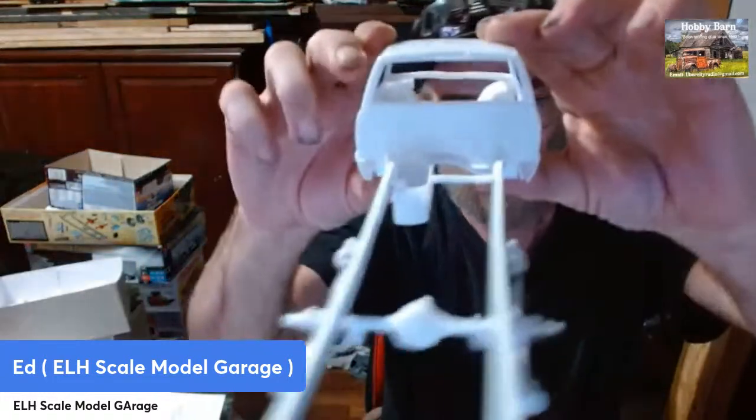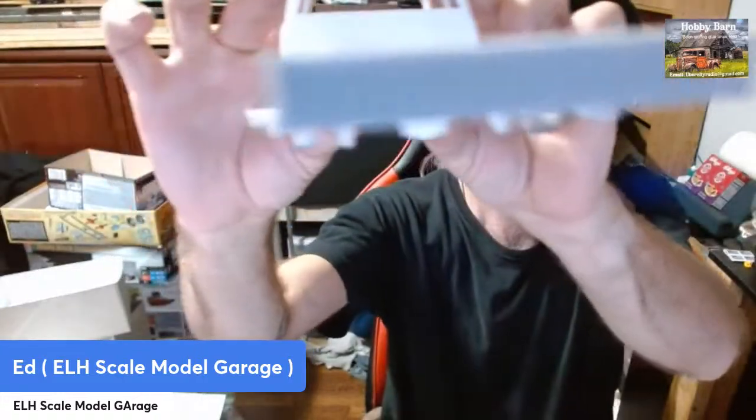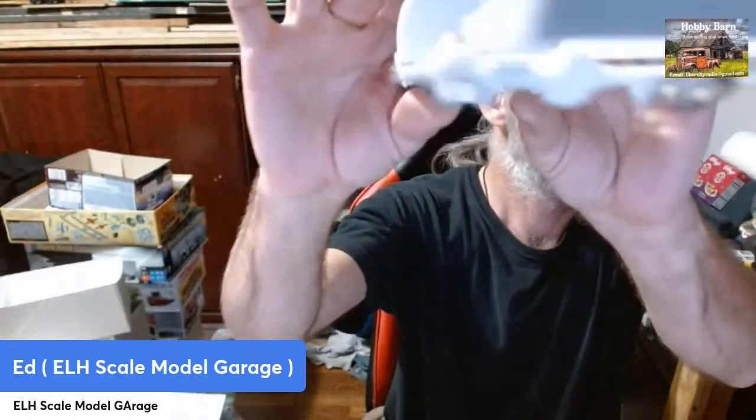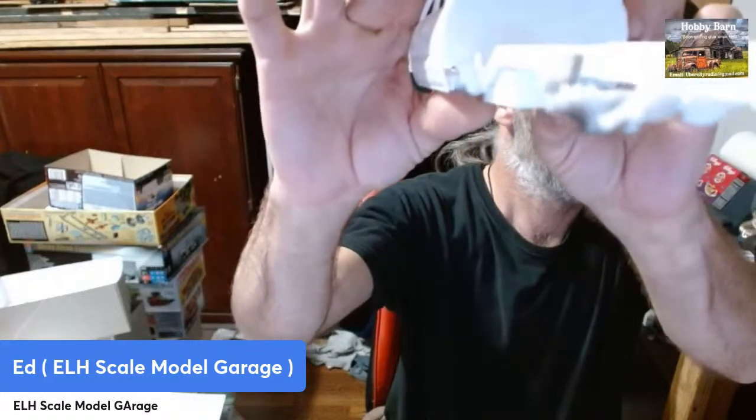That might work. I mean, make it actually a floor pan in the body, to tie both rockers together. And then you're just basically setting the frame back down onto it where it belongs. Because that's a lot of work to secure that so it doesn't snap. But that's the last thing you want to happen, is to have the body snap.